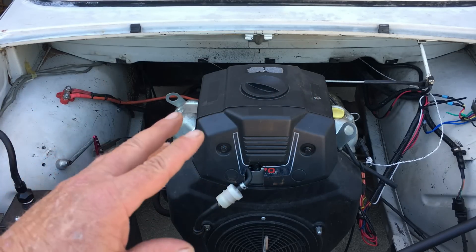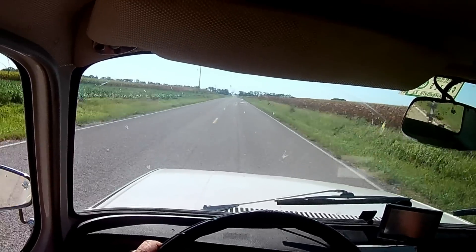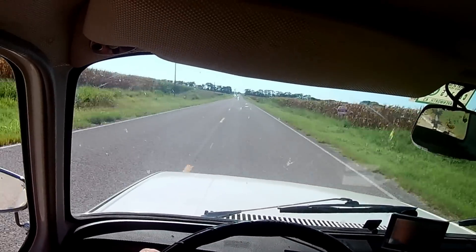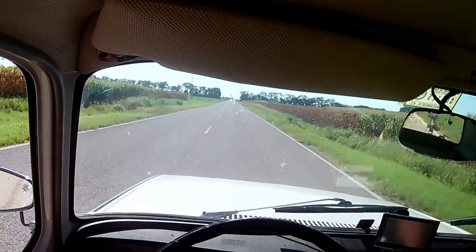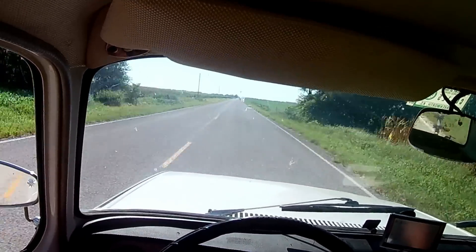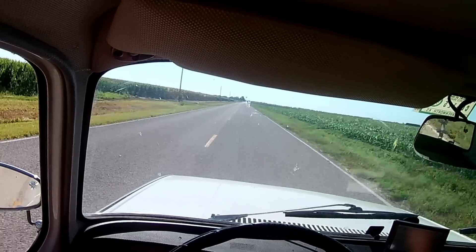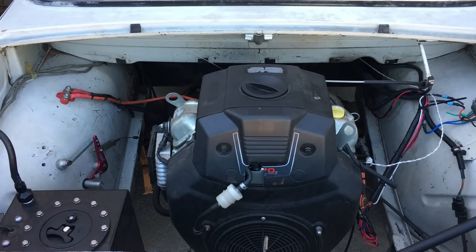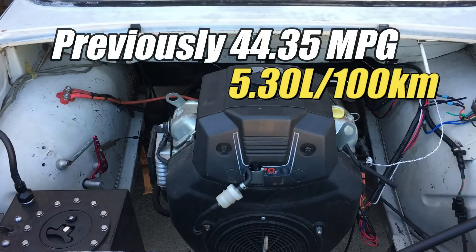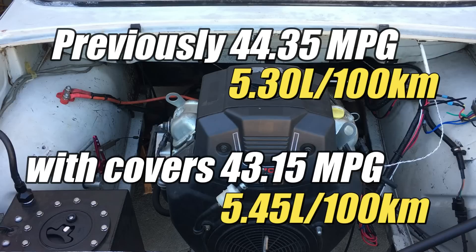With the silly plastic covers back on the engine, the upper intake manifold may be able to absorb some heat, and perhaps we may see a difference in fuel economy. Right away I noticed a difference with the plastic covers in place — the most noticeable thing is the engine is slightly less noisy. Also, I'm noticing the air-fuel ratio is slightly richer, but not by much. I have to drive about 35 more miles before I can head back to the shop to see if the stock air filter is better or worse than the custom one. Through the magic of editing, we are done. With the original air filter and all the plastic covers on the engine, the fuel economy dropped slightly — and to be realistic, this drop is within the margin of error. However, I did notice the wideband gauge was indicating an ever-so-slightly richer air-fuel ratio. The things we learn when we experiment.